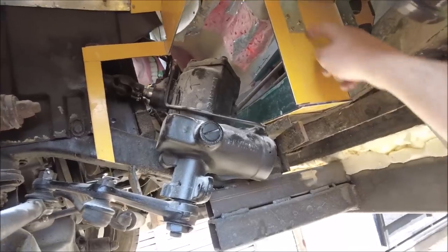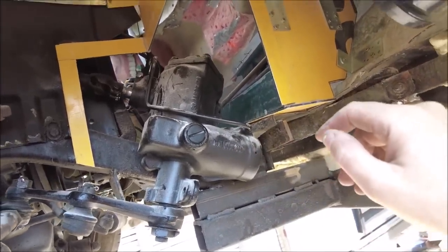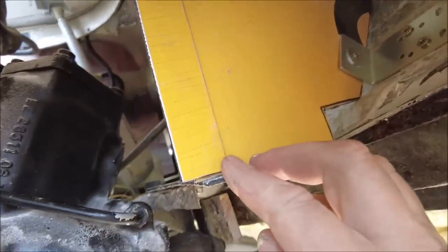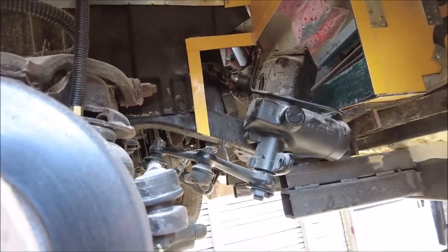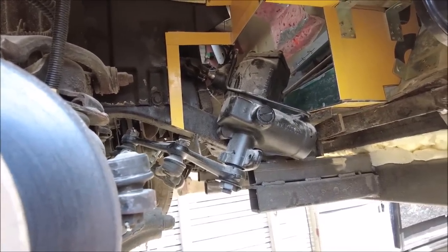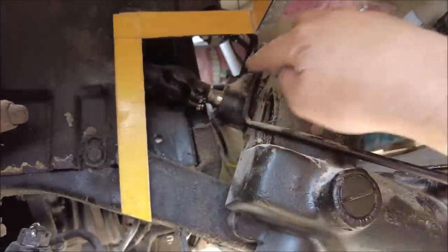And I've panelled this out, with a few stretcher plates, a few tek screws and stuff. Just got to keep the water out. So, put these in, and then what I've done here, shame it's yellow on yellow, but I've put strips all the way around this, and they're going to come off. And what I've done there, I've glued them on with a bit of Mitrefix, just a little bit to keep them there. And now what I'm going to do is fill this gap.